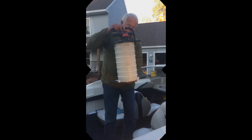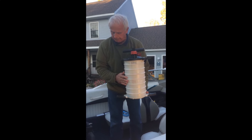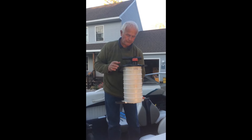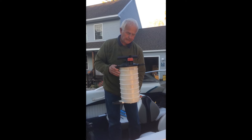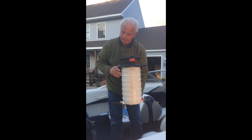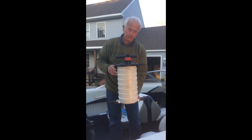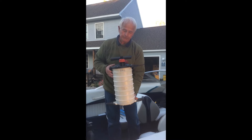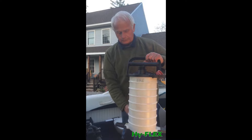This is the vacuum pump we use to not only extract the oil out of the engine itself, but also out of the filter. What's great about this pump is that with the pumping of the handle in both directions, it'll create up to 28 inches of vacuum. That's another reason why an oil filter will be emptied so fast — it's the combination of vacuum and atmospheric pressure.